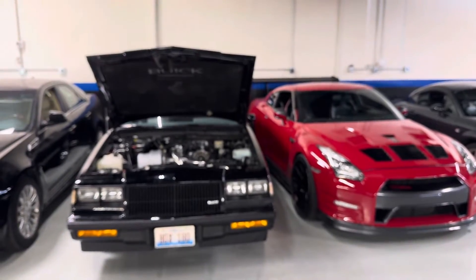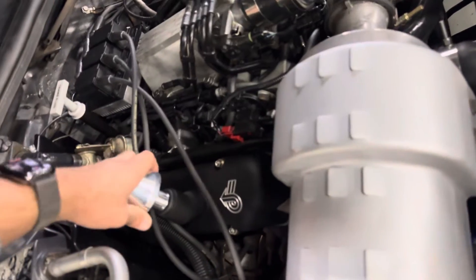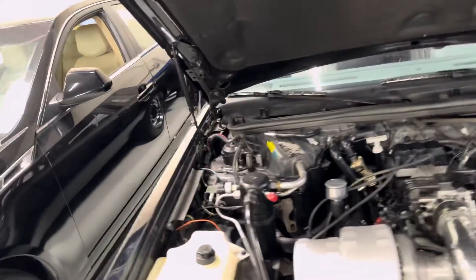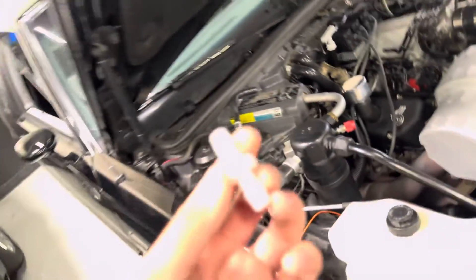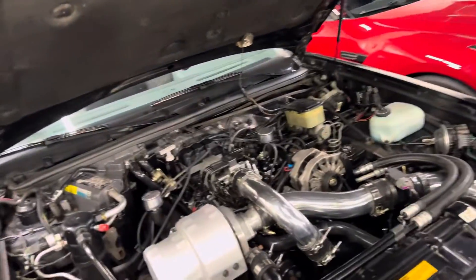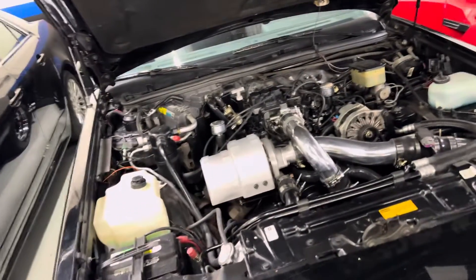I'm really happy with how the engine's going to breathe now. On a stock turbo I don't really feel I need a catch can. I wanted to show you that little trick to make sure you have no excess crankcase pressure under boost so you don't start pushing oil through those seals. The check valve is so nice — it's going to help the PCV so you don't have to rely just on the factory PCV system, which did fail with higher pressures from our shop air. These check valves — I'll put a link below — I bought two off Amazon for like 10 to 15 bucks. Very simple but very effective. I'd highly recommend them on older boosted applications.